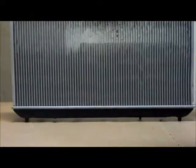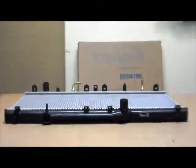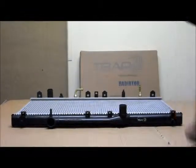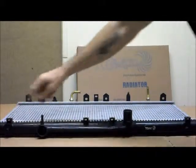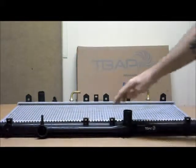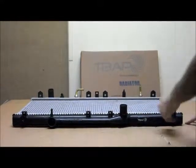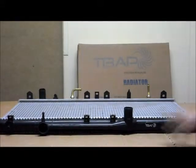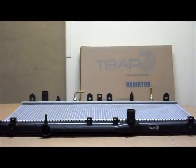I'm going to stand around and show you — this will be the front of the vehicle. So if you're standing in front of the vehicle looking into the engine bay from the top, that's the view you would have. You can see 2 round mounting pins on the outside and 4 fan mountings across the front. Over here towards the passenger side is the top hose, and more towards the driver side you've got the cap with your overflow pipe facing the back of the vehicle.